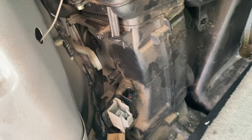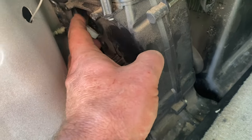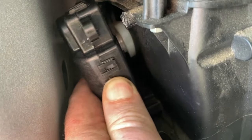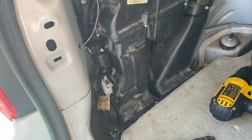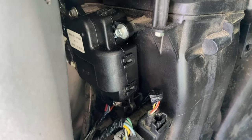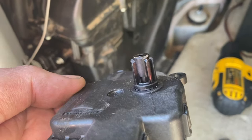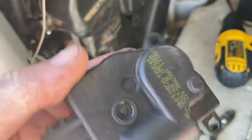Once those three screws are removed, the blend door motor controller slides right out. You can see the arm that actuates from the motor right here in the back — the arm has a keyed sprocket design, so it only fits one way; it'd be pretty difficult to mess this one up. I just lined up the sprocket and slid it right back into place. There's a cross shape you have to line up to get everything to pop back in, but that's it — really easy. I reinstalled the 7/32 screws and reconnected the harnesses. Since the blend door motor control is so old, I'm sure it failed — you can see the arrow doesn't line up anymore, but it still has the original part number with a time and date stamp on it.